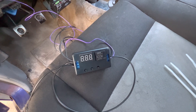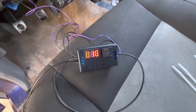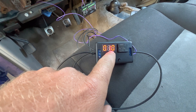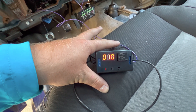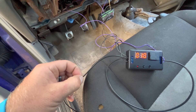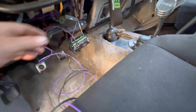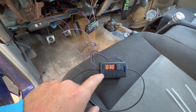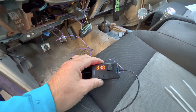After messing with the glow plug timer for about 10 minutes and reading the instructions 25 times, I finally figured it out. It's set to 10 seconds — whenever the middle terminal gets power it counts down, sending power to the glow plug relay the whole time. I still need to wire this to a push button so I can click it once and it counts down from 10. I'm stealing power and ground from nearby, with power at the top, signal in the middle, and ground on the bottom. I'll add links for this timer and the Dakota Digital in the comments.